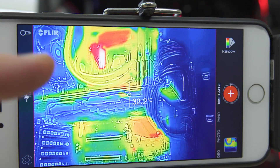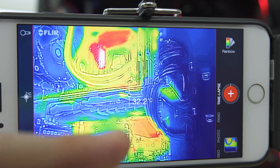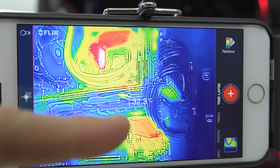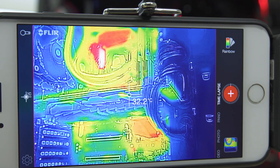You can see the tubes have warmed up a little bit. The VRMs are pretty damn smoking and the chipset didn't change too much. But you can see right there that we've got some pretty intense loads that take place on the CPU, especially when they're overclocked — right now overclocked to 5 GHz at 1.4 volts. In fact, this H100 can't even really keep this cooled like it needs to. So I'm gonna go ahead and stop the test before I blow it up.